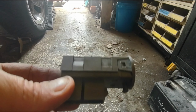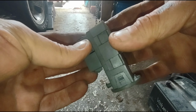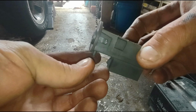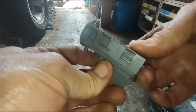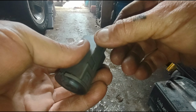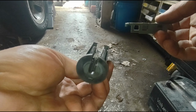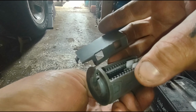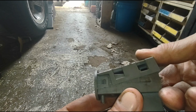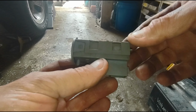Alright, so what I have here, let me turn the light on. I have what they call the clutch safety switch. And what it is, that rod that goes into your master cylinder for your clutch goes through it. The way you get these things off is, it's going to be up in the truck in this position. You unhook your wires. You pull back here on these corners, and they're tabbed. So if you pull on that and lift it up a little bit, do the same thing on your other side. Then you can lift this top off. Then you put this up on your rod. You want to take your front edge here, and there's a couple little ramps that it goes underneath of, so you want to make sure that is sitting underneath there. Once you put your rod through it, snap it down, reconnect your wires, and this is what lets your engine start when you push down on your clutch pedal.